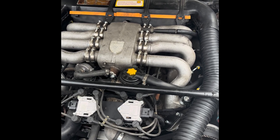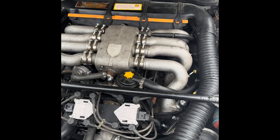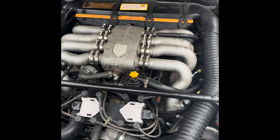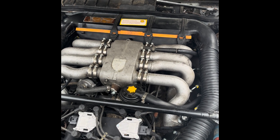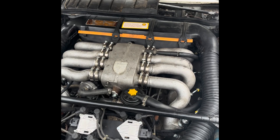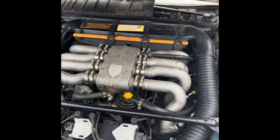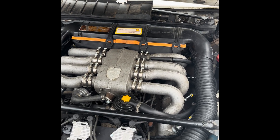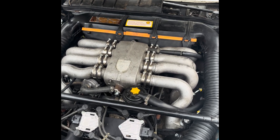The ECU reads all those inputs and controls the engine in a modern fashion. I'll walk over to my 924 and show you the fuel distributor and how the system looks for the 924 in a minute. I've designed these things for the 924, the 924 supercharged, and the 924 turbo before doing the 928.